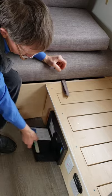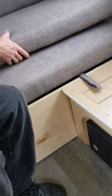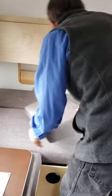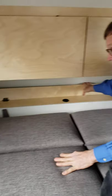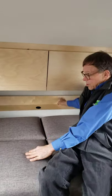This would be the power converter itself — it has both the 12-volt fuses and the 120-volt. This was very clever the way they designed the storage area to be a slide-out bed; that isn't something I've ever seen in any other camper. There is a storage area behind the couch, good for blanket storage, and you've got one like that on the right side as well. In the back here you have some deep storage pockets that go down about six inches. The gap across the back is for the radiant heat — there are double rows of thin radiators under there, and that gap allows the heat to come pouring out.